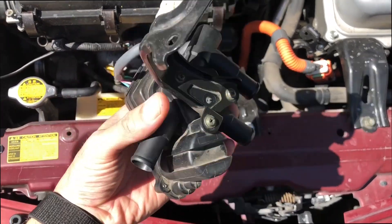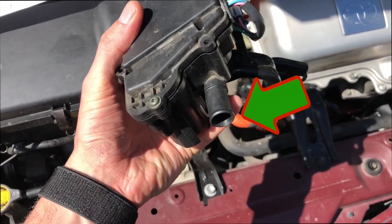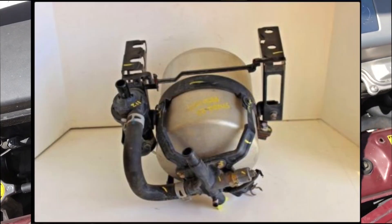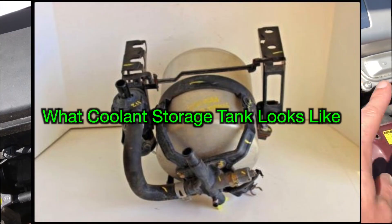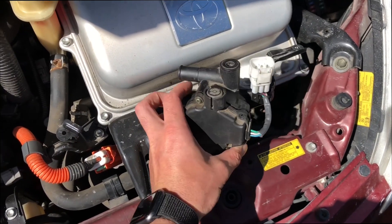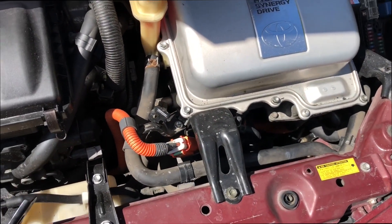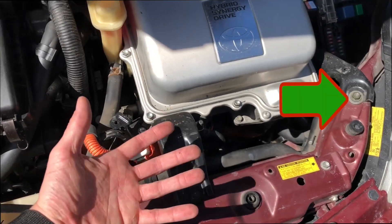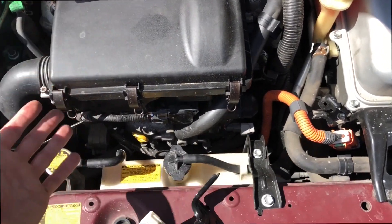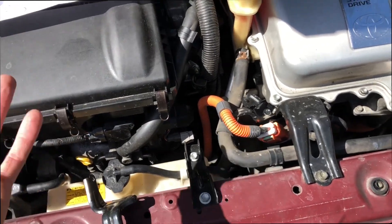I just want to give people that are pretty good mechanically the quick tip: you do not remove this lower hose. This thing sits in there like this — this lower hose is the one that's really hard to get off. You just crack these two and you remove this lower hose from the coolant storage tank, which is on the driver's side fender. You jack the car up, remove this hose there, and pull this whole assembly. My video camera died, so I didn't get the actual removing of this valve. But you're going to pull this valve out of this cavity. You do not need to remove any headlights. Remove these two bolts, lift this inverter up, and put some blocks of wood under there. The hardest part really is going to be bleeding the coolant without a vacuum tool. I could have it in and out in 30 minutes — the bleeding takes longer.